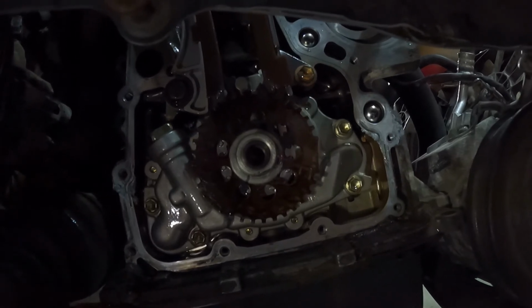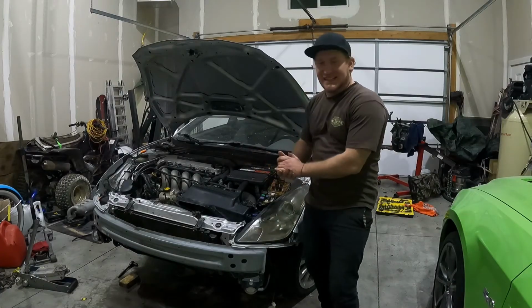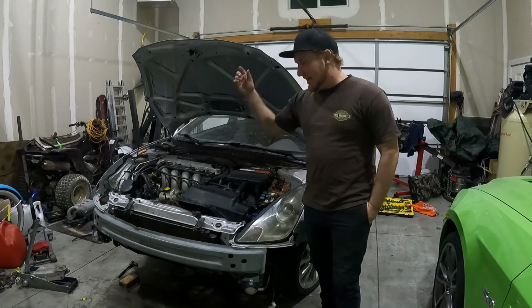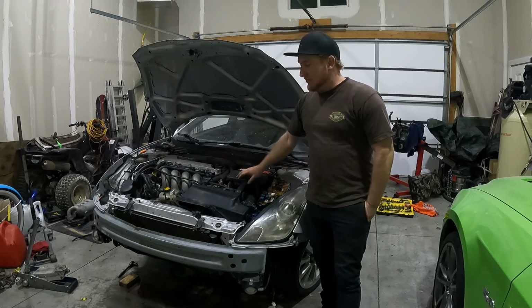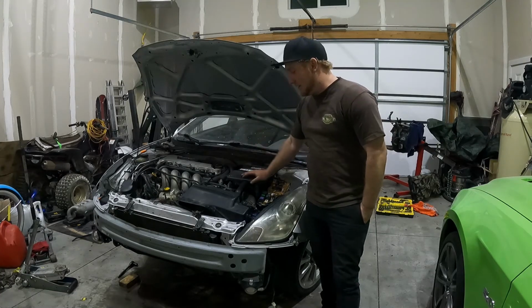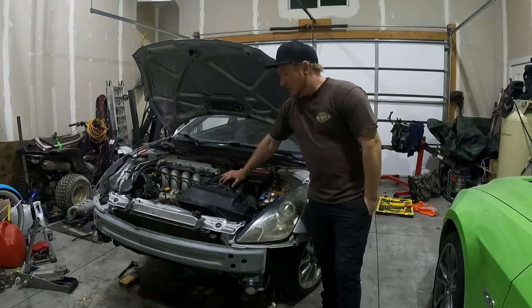All right, that's gonna do it. Let's get this thing put back together. All right, check it out. We're back together. Everything's happy, I'm hoping. But I went ahead and swapped out the radiator from that stupid little hose that I broke off. I replaced the fan shrouds that had a chunk out of it. For whatever reason, I just swapped the whole thing. And then I went ahead and really deep cleaned the throttle body.